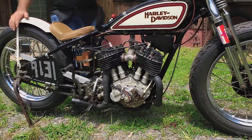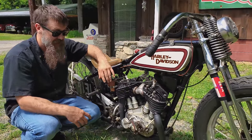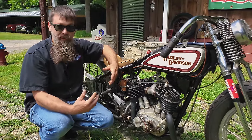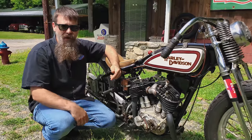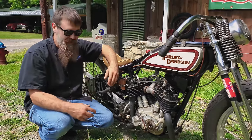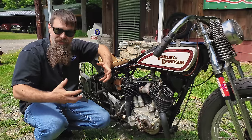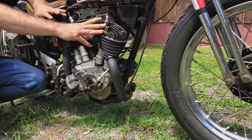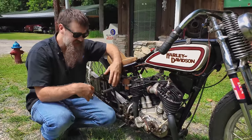One of the reasons we chose the DL for our land speed trial in the 750 class — the 45 cubic inch class — was that the DL lower end is significantly lighter than a Harley WL or WR bottom end. Harley made the WR from 1941 to 1952 as their factory racing platform for Class C. The WR engine weighs about 120 pounds, while the DL engine weighs less than 90 pounds. So right off the bat you're saving weight. The flywheels for the DLs are also considerably smaller — less rotating mass.